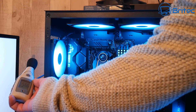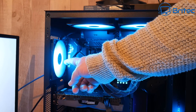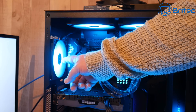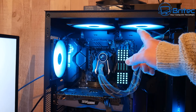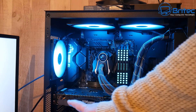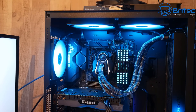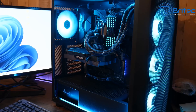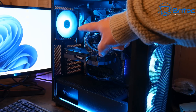There are also reasons why your PC may be spinning this fast because you may not be connected to a PWM connector. This is our exhaust fan here and you can see it's spinning pretty fast and that's what's creating the loud noise. We also have two extraction fans up the top, a closed loop water cooling system with a small fan, two fans on the GPU, a fan on the power supply, and three fans on the front. Having this many fans without any PWM control on the motherboard is going to create quite a bit of noise.